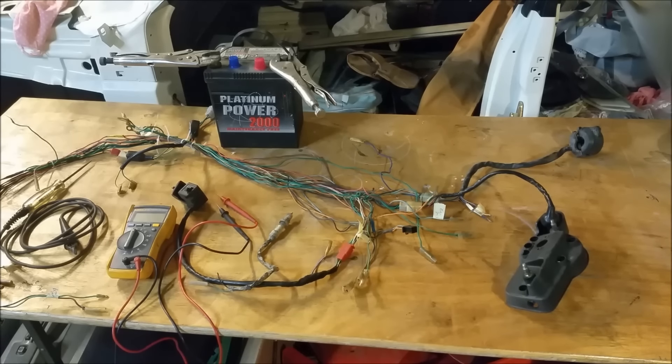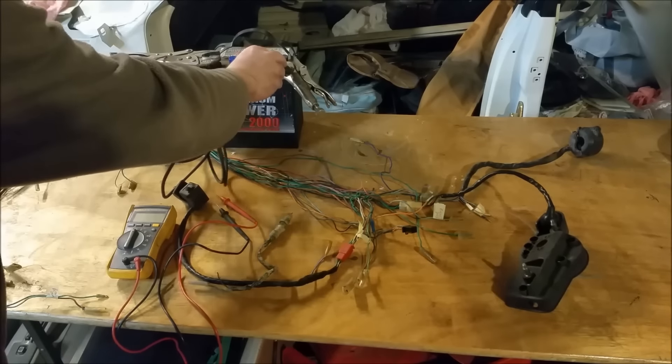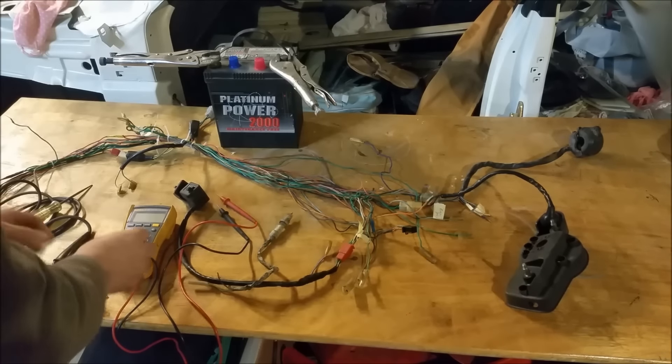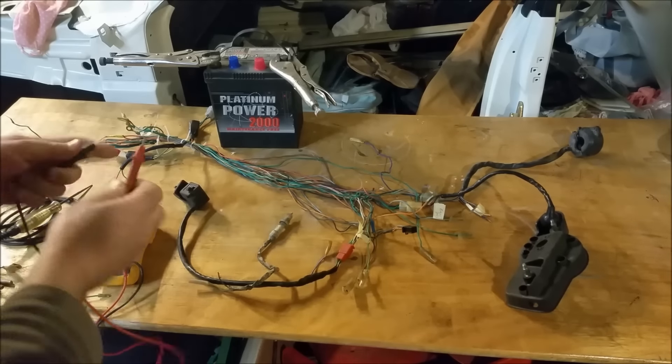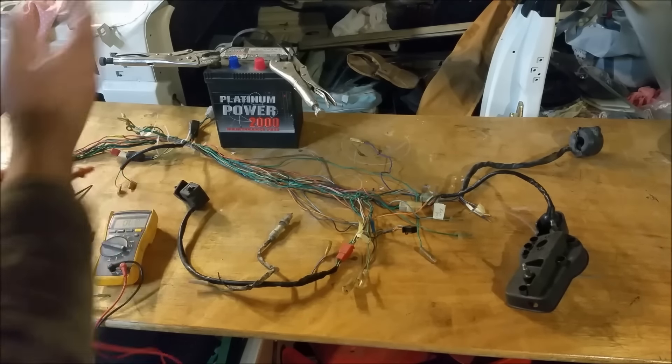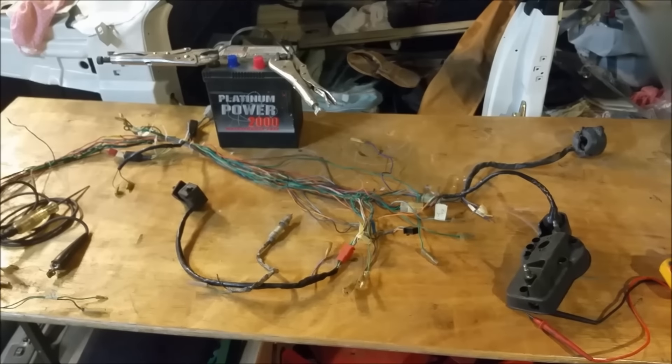The reason for that is I've got a power supply from my Boxford tape days and that only goes to 1 amp, and of course I'm going to need at least 5. So basically there are only two tools: we're going to need a test light to see where power comes out, and a multimeter set to continuity. If we have trouble with wiring, we can see if we've got the right one and that sort of thing. They're the only two tools we need to test the integrity of this wiring.